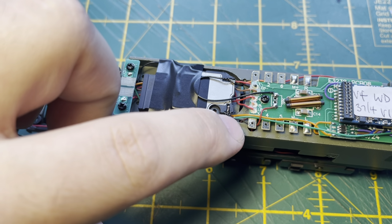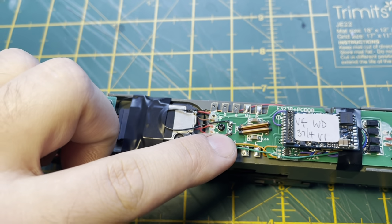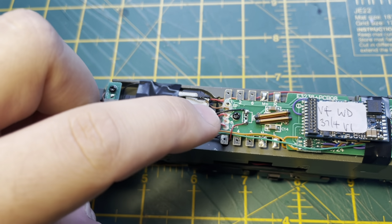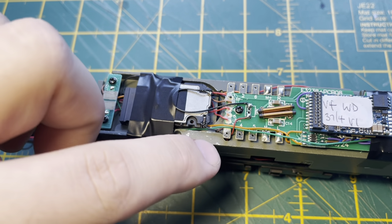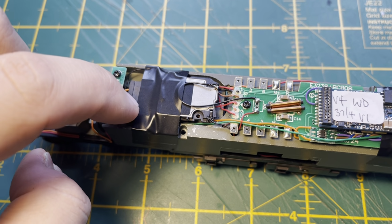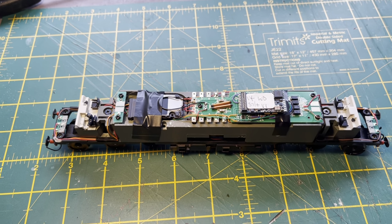So basically one wire from the EM1 speaker comes up and goes on the speaker terminal on the PCB. The other speaker terminal goes to one side of the iPhone speaker. And then the other side of the iPhone speaker and EM1 are both connected straight together, and that creates your circuit. It won't be as loud as if you have them in parallel, but a V4 can't really cope.